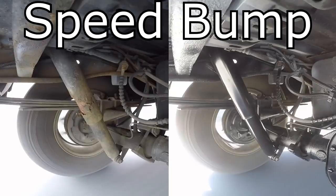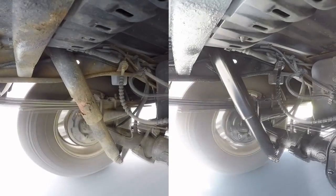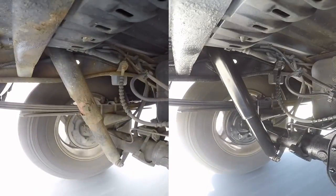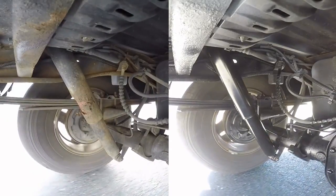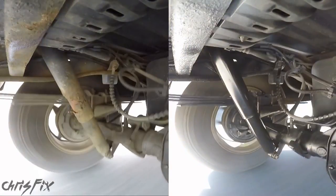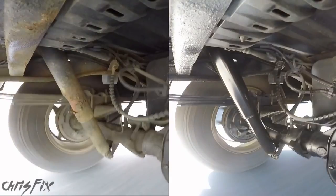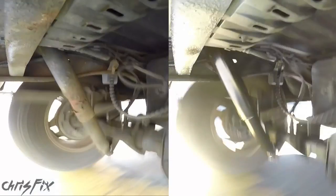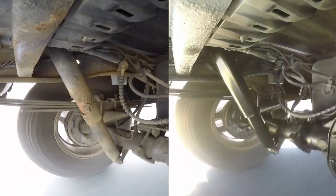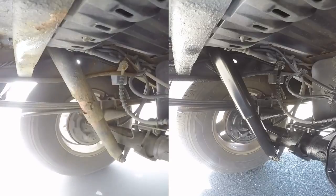And finally, let's get a side by side at the speed bump. Interestingly, the softness of the old shocks did a good job at preventing a big jolt, while the new shock has more of a jolt to it. But you have a lot less bounce afterwards with the new shock, so you maintain more control. Just to give you a frame by frame — check out the spring in the before compared to the after. You can see the new shock dampens the leaf spring a lot more than the old shock, and there's a lot less rebound. This proves the ride is actually stiffer and not just in my head — you can actually see a performance difference between the new and old shock.